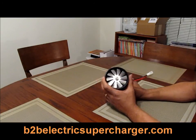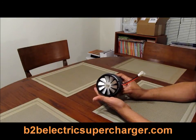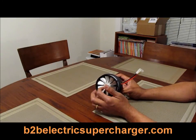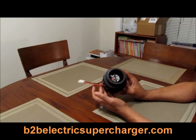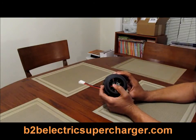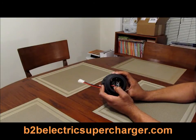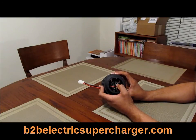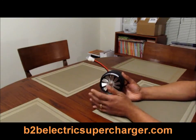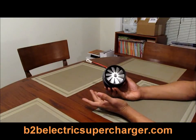Now let's take a look. A lot of them have the same specs: 24 to 26,000 RPM, 12 volt motor. Are you into RC cars? Because if you are, you'll know what this motor is. If you take a real good look at it, it's a 550 motor — the same 550 brushed motors that you get from China as your stock RC motor. They all have a similar design, but they have different boost ratings.